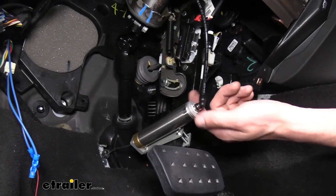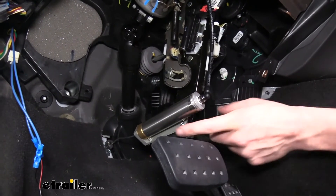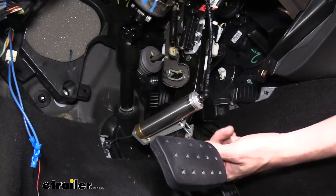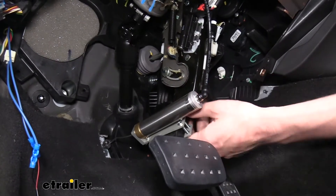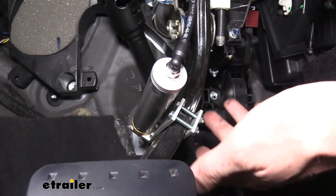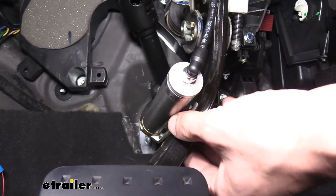On our brake pedal we mounted the actuating cylinder by taking the bolts loose — there's a plate that slides off. We can then take the studs on our actuating cylinder, slide it over the pedal, put the plate on the other side, and reinstall the bolts. Due to the shape of this pedal it likes to slide around, so use a ratchet to get a little extra tightness. I recommend starting with the socket by hand until as tight as you can get it, then come back for an additional turn on each one with a wrench to ensure it won't move around.